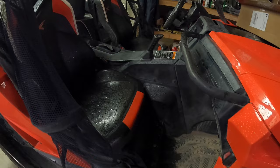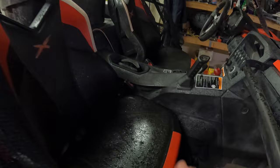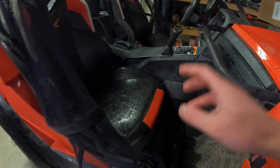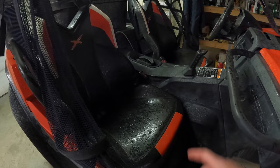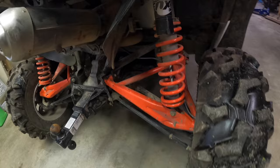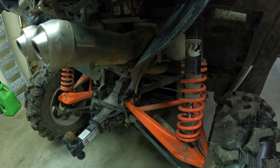To get started, you've got to get yourself some access to the driveshaft. Your motor is up in here, you've got your transmission, and your driveshaft hooks in right back there to the side of the seat. So you've got to take your seat out, take the side panels out, and that'll give you access to the front of the driveshaft. That is held on by a 13mm bolt that comes into the front of the yoke and bolts to the transmission output shaft. Then here in the back, I had to unbolt the rear diff so it could slide back a little bit, and then the whole driveshaft was able to just drop right out.